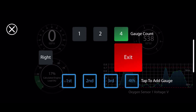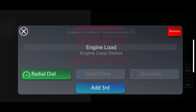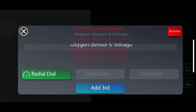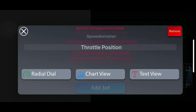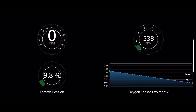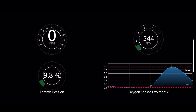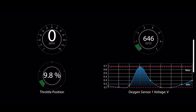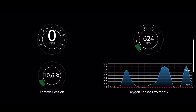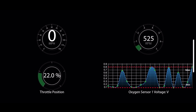If you click one of them — say you want to change engine load — you just go through here and everything highlighted in white works for this vehicle. The newer the vehicle, the more options you'll have. Like throttle position — you just hit that, hit add, and there we go: throttle position at 9.8 percent. If you hit the gas you can see the engine RPM go up and the throttle position go up.